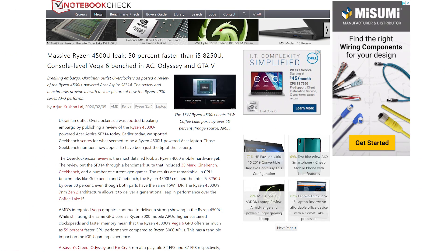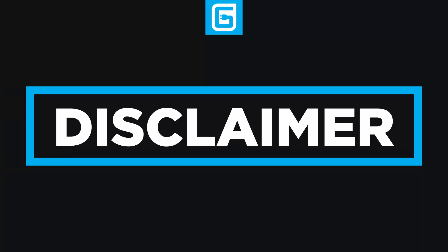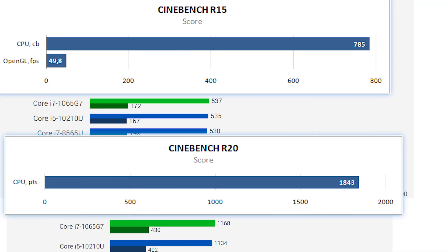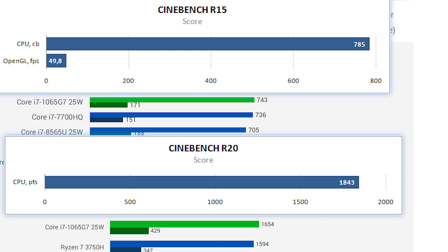Moving on to the CPU — it is a bit tough to compare it to Intel's parts because most have multi-threading while this one doesn't. I personally think it's best to compare this 6-core, 6-thread part to a 4-core, 8-thread part. Keep in mind this is a Ryzen 5 part, so it's more of their mid-range offering and will likely be in mid-range notebooks. When we compare it to Intel's i5-8250U, Notebook Check says it beats it by over 50%. Comparing it to Intel's best 15W 10nm Ice Lake part — actually an i7 but a 4-core, 8-thread part — the Ryzen 5 4500U crushes it in Cinebench R20 and R15. And when we compare the 4500U to Intel's 10nm i7 configured up to 25W, AMD's 15W part still wins.